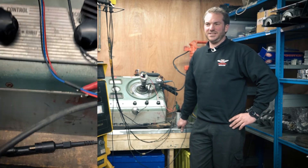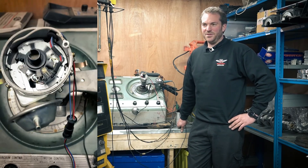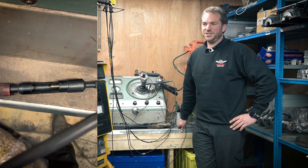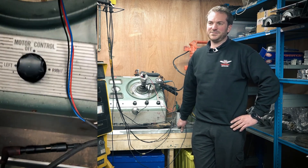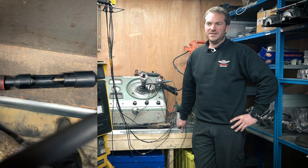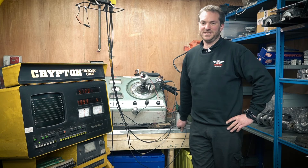Here I'm testing the Lumination ignition system. You can see the gap has a really good fat spark. We had a voltage of 17.5 kilovolts and the maximum gap it jumped was 20.5 millimetres, which ended up being the best one out of all the systems we tried on a six-cylinder distributor.